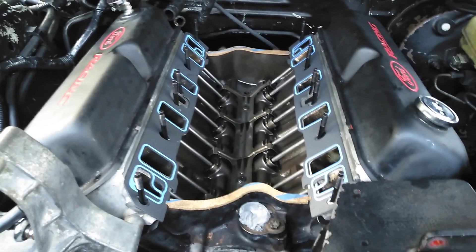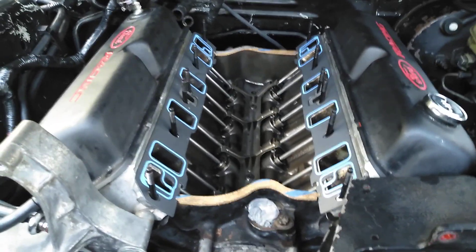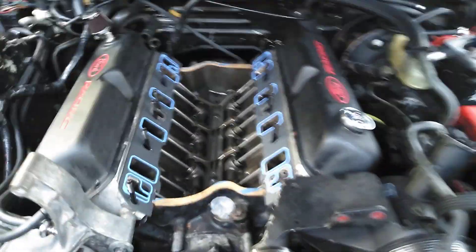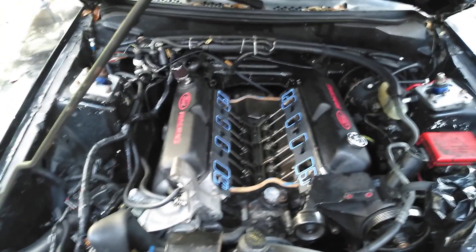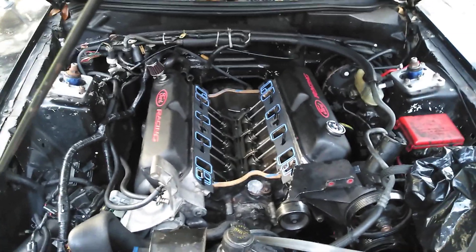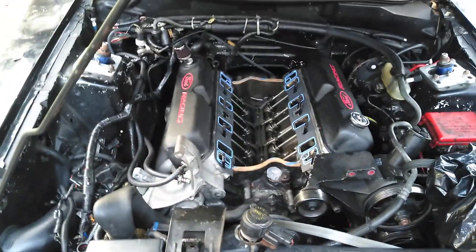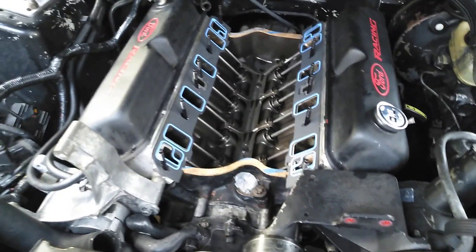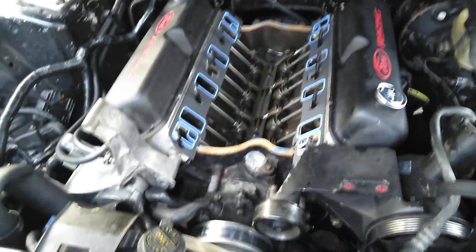It did come with intake bolts, and that's the issue. The Pro Comp I had on there was leaking and it didn't have the correct gasket. The gasket was a 1250 FelPro — it needed a 0.070-inch thickness gasket. These are the 1250 FelPros that were on it. Maybe because they were decked they needed less of a thickness of a head gasket.